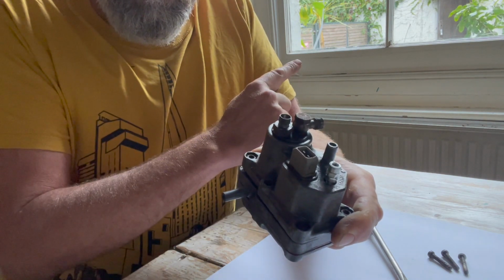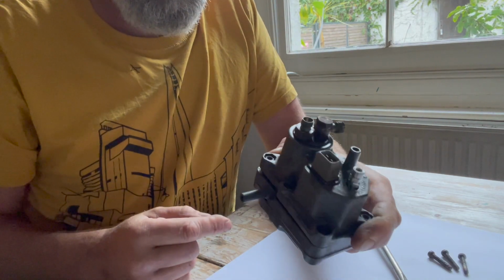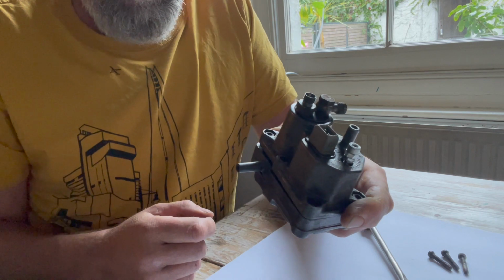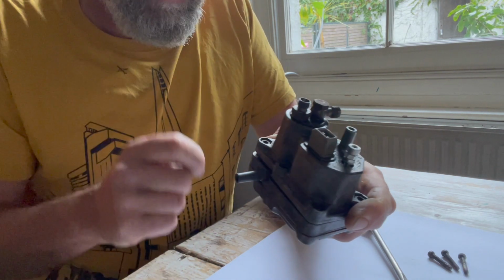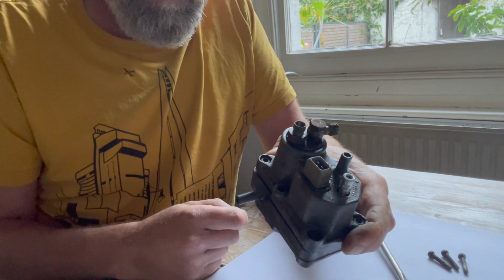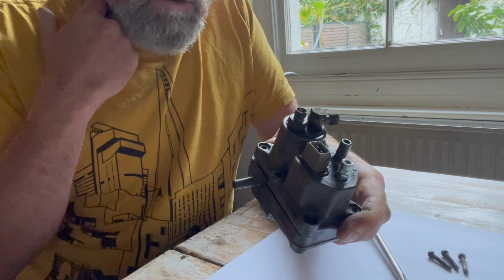that the fuel system can put more fuel into the engine, and we'll probably talk about the fuel distributor as I understand it. Anyway, it's a massive learning curve, all this stuff, and I'm still not quite right, but that's how I understand how this works. And this is quite a complicated one because it's got two vacuum ports on it that can signal depending on what the engine's doing to make it more drivable.